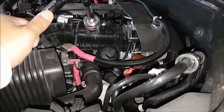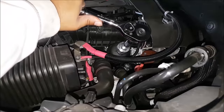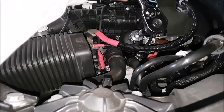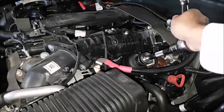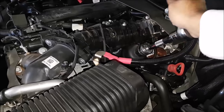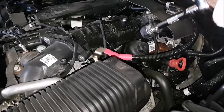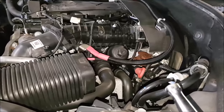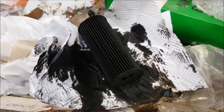There's the engine oil filter - it's a 27 millimeter. It's a lot harder to do with one hand, let me try that with two hands at least to crack it open. That was on very tight - at least I managed to get it loose. Not going to undo it too much, I want to get some tissue so I don't cover the engine bay with loads of engine oil. There's the old filter in the junk pile.